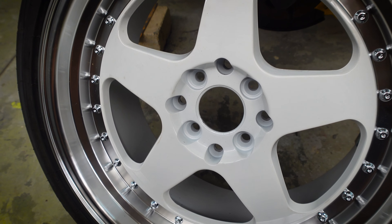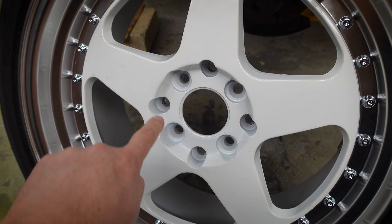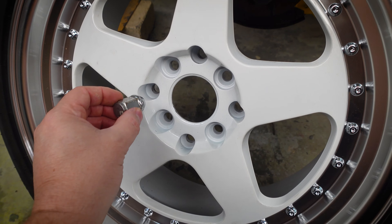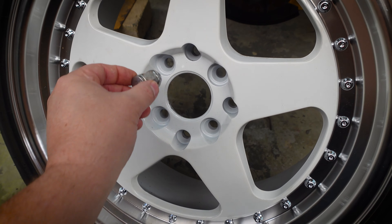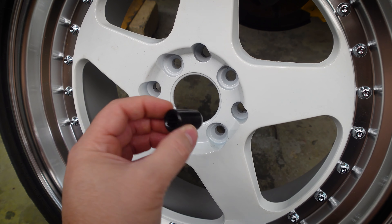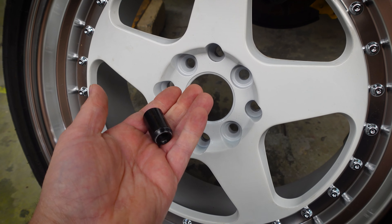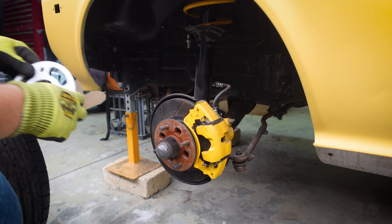One other thing on this multi-fit pattern: I'm using the larger 114.3 setup, which is heavily countersunk into the rim. A standard 12 by 1.5 nut won't fit properly — it's not centered in that hole at all. So I've got a set of internal hex wheel nuts, which fit fine. I don't mind the black in there — it looks a bit more racy, and without a tool running on the edge, we hopefully won't scratch the paint. On to fitment — starting with the 5mm spacer.